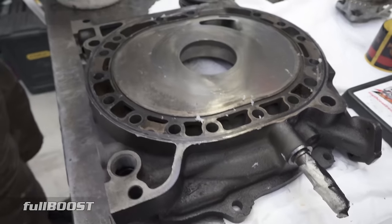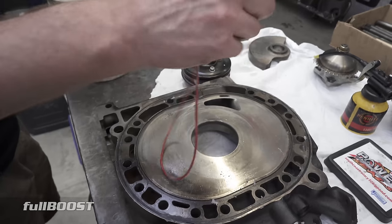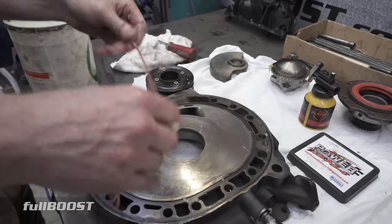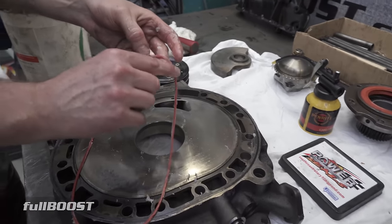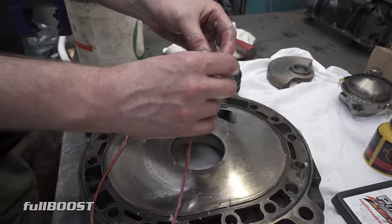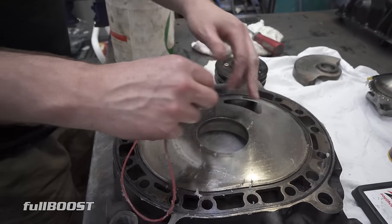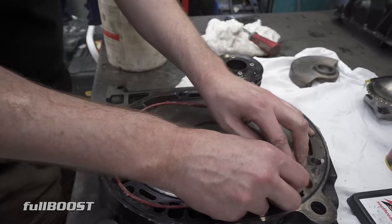This is the PowerSeal O-ring kit — these are one piece, no join in them. If you're using a Mazda seal, you'll see there's a green join area because they're actually a join seal. You have to put that join area just above the intake port — that's the coolest part of the engine — to protect that join from extra heat.